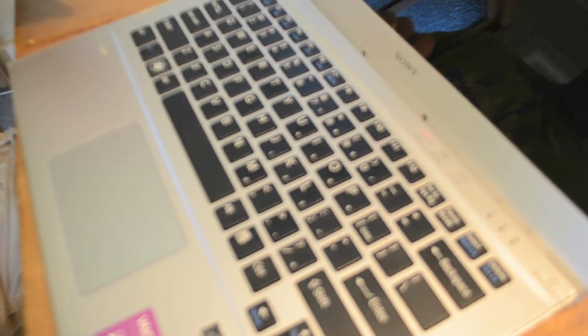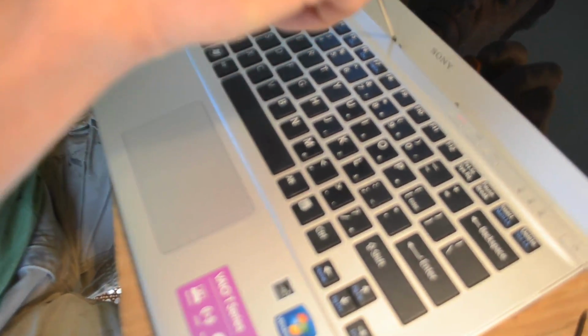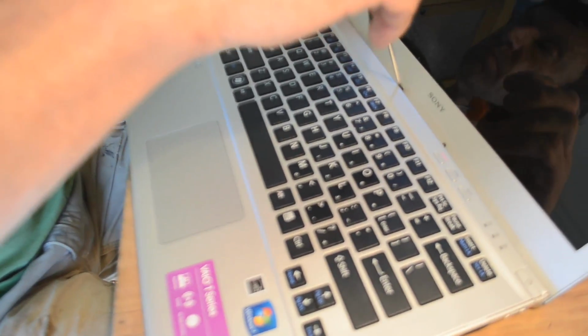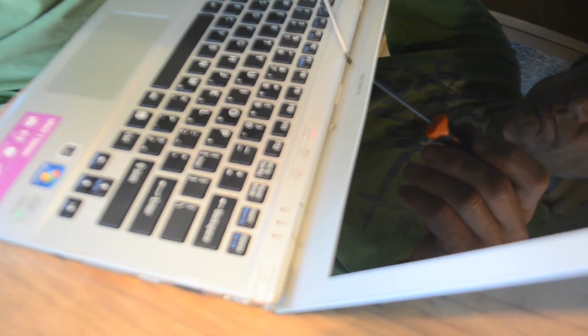Because of their low position on the bezel, they are a little tricky to remove because you can't get the screwdriver head perpendicular to the screw head. But if you apply firm pressure through the screwdriver to the screw and unscrew slowly, you should be okay. The head of the screwdriver is not magnetised, so using some tweezers helps to pick up these small screws.